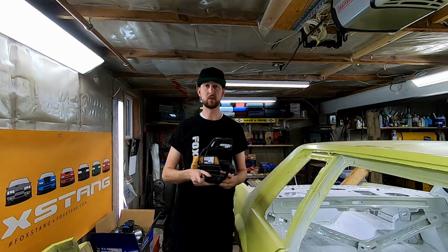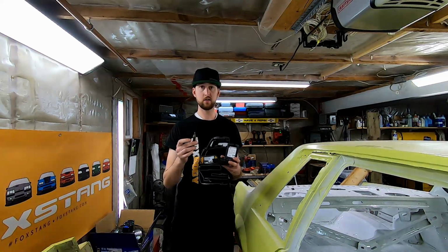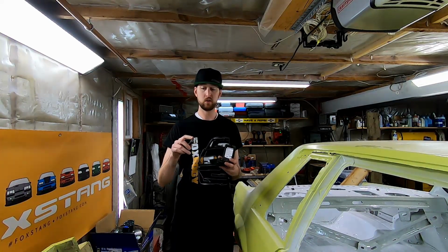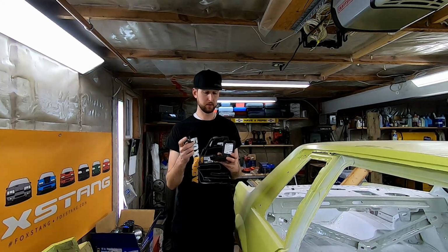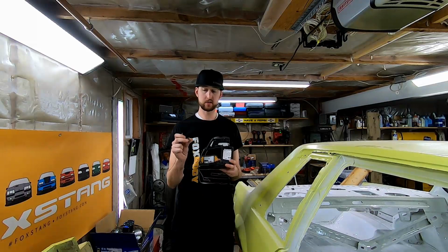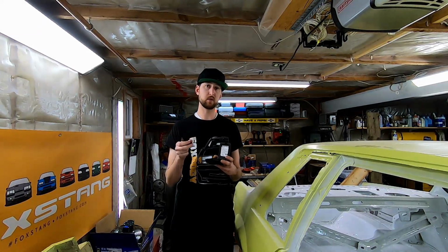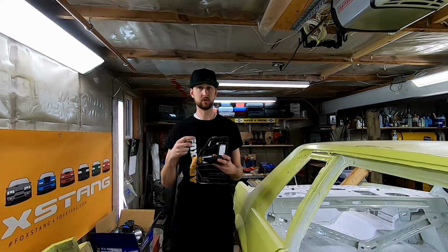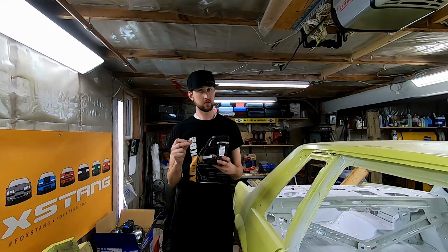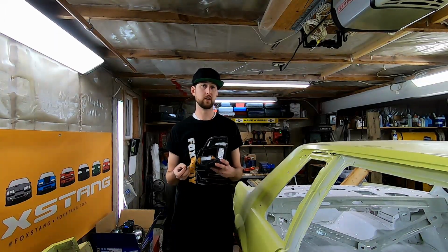So here we have our spot weld cutter kit, and this actually comes with a spring-loaded pin on the end. If you start a bit of a pilot hole, then that'll actually keep things lined up. We actually have a cutter here that has 4 different blades. There are some replacement cutters, and this basically goes around the outside of the spot weld and then allows you to cut through that upper level of sheet metal without disturbing what's underneath. Also, this allows you to have a nice round opening when you put your new material underneath to actually do